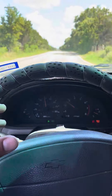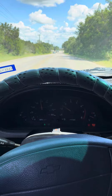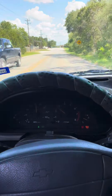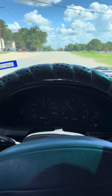I lifted the wheel up the other day and tried to shake the wheel just to see if there's any play sideways and then top to bottom, but there's no play in the wheel. So there must be a bushing somewhere else. The tie rods seem good and the ball joint seemed good, so I don't know what it could be.